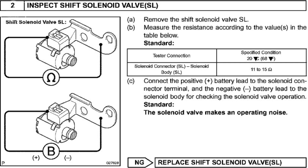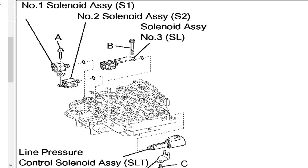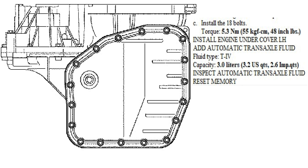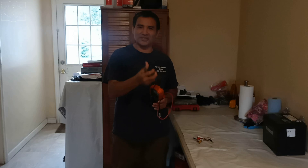Here is the Toyota software with the official instructions on how to test them. One quick tip: if you're having trouble finding which solenoid is bad, just test all of them — the one that doesn't pass both tests is the bad one. If you have a problem with the two-wire solenoid, that one has a different testing method and is not covered in this video. If you found this helpful, please like, comment, and subscribe. Thanks for watching.